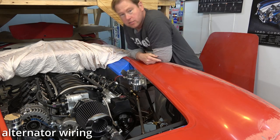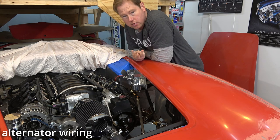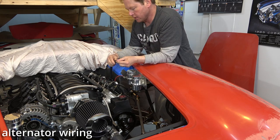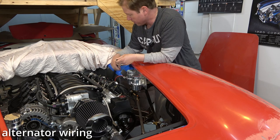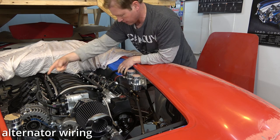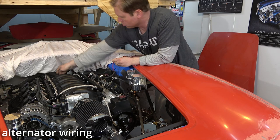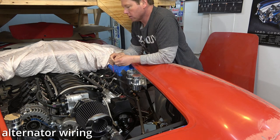So that leaves the wiring, which shouldn't be too bad. There were 3 wires that went to the alternator, which used to be over here, but is now over there. This primary connection here is the Ron Francis chassis wiring, and it's kind of on its own, so I should be able just to pull that through and snake it over there. This is in the engine wiring harness that goes to the adapted fuse block over here to power the wiring harness.